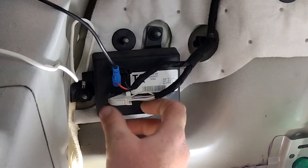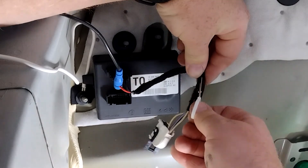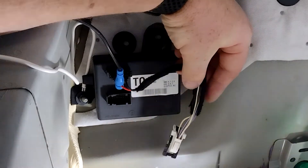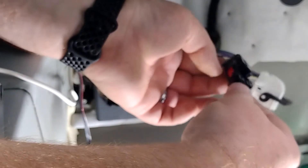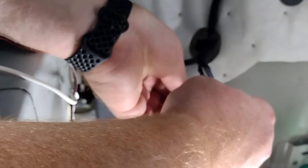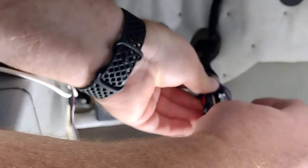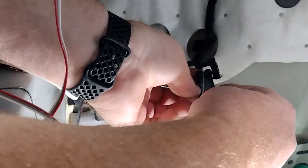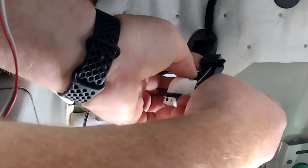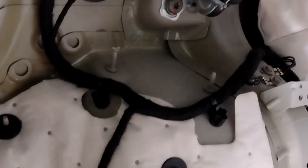Unhook this connector and carefully cut back some of the sheathing around the wires. Locate the yellow and white wire and install the clamp marked STOP. Attach the clamp marked TAIL to the brown and gray wire. The turn signals are accessed from further back — it's a pain to film and an even bigger pain to work on, but I'll do my best.